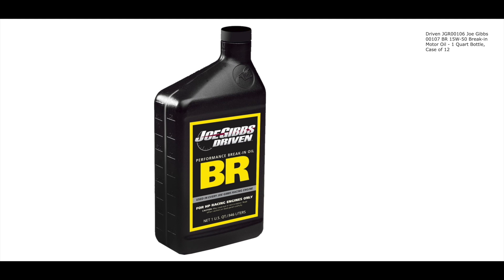Step 1: Put oil in your engine — and not just any oil. I use Joe Gibbs break-in oil. Break-in oil or mineral oil is what you need to use. In the S62 5-liter engine, it uses 6.5 liters. So that's a lot of oil per change.